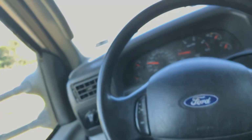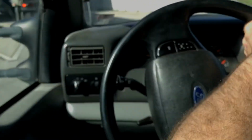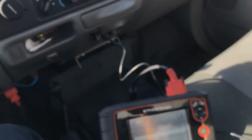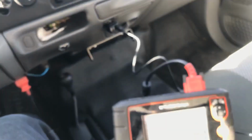Now we'll get back real quick and we'll find out if, let's do a little hillbilly head gasket test, make sure it's not head gaskets causing it, which if there ain't no puking, we'll see. This is already studded and deleted, so it should be good. So let's see. Right there, dropped right back down to 195. So maybe that fan just lost, I don't know how it's built inside of it, but maybe it just lost full lock function, maybe it did. Because it's a variable speed, it was locking up a little bit, but it wasn't going full bore lock. So that's what we need.